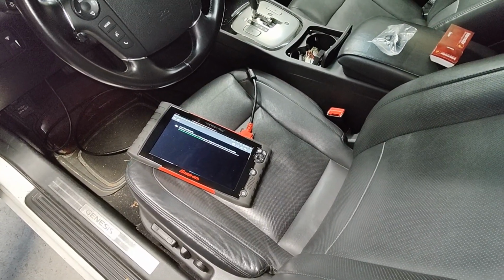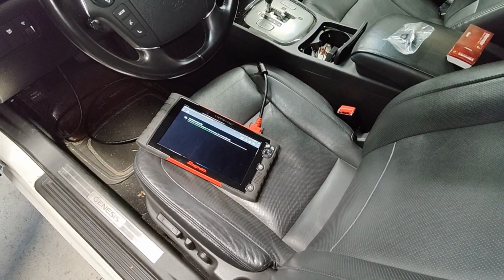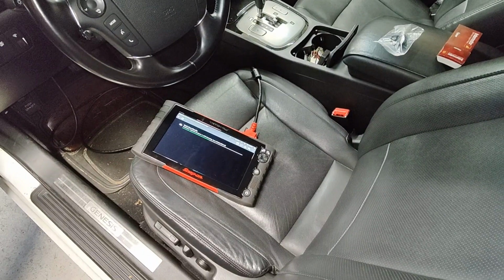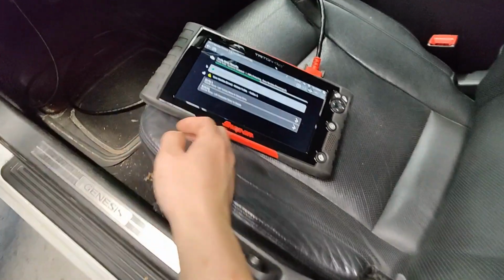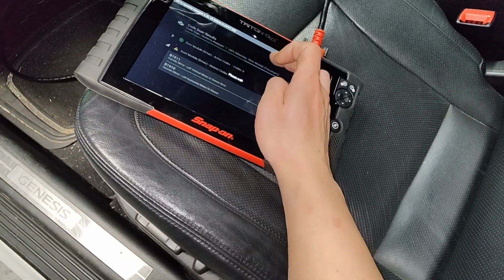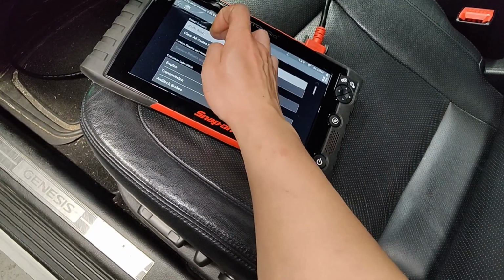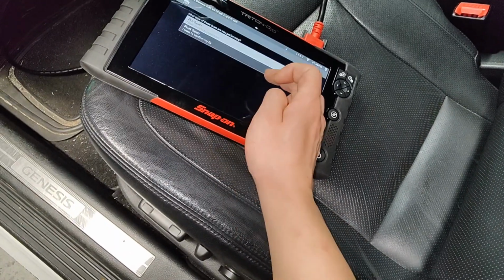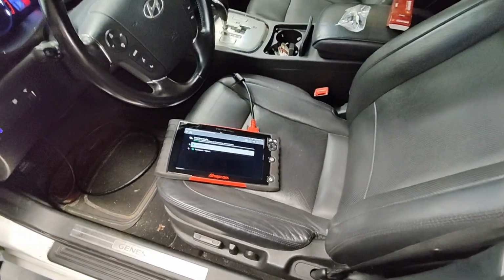When I started putting engines in. But yeah, other than that, we do get a lot of, well, Hyundais are pretty bad for crank sensors, low mileage, stuff like that. I just got to rescan it because it didn't have the car on. But yeah, they're pretty bad for crank sensors, either in the Elantras, Hyundai Accents, Velosters. The same complaint as always: you come to a stop and the car stalls out on you.